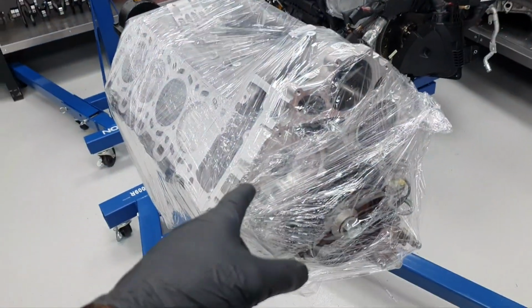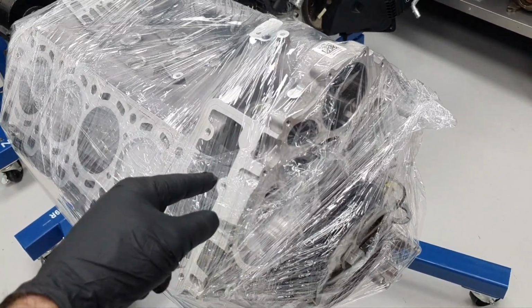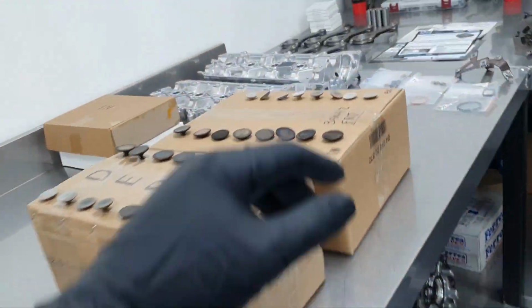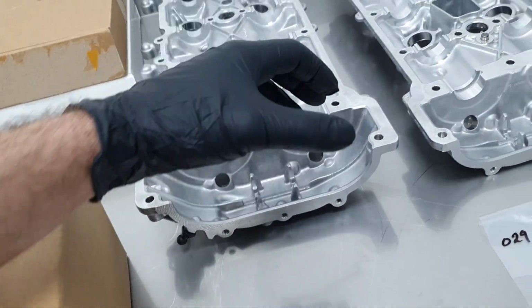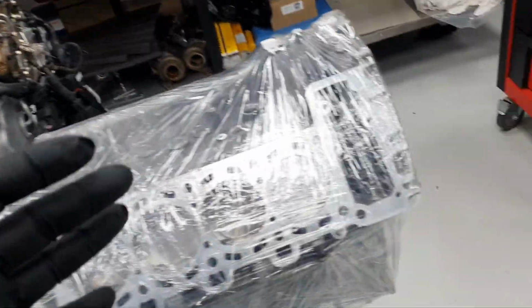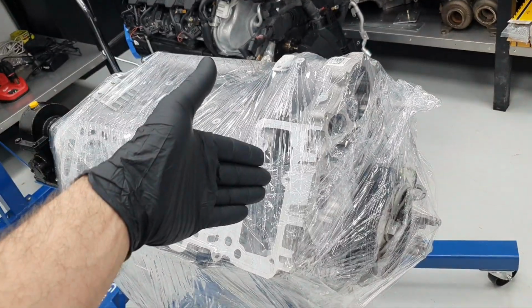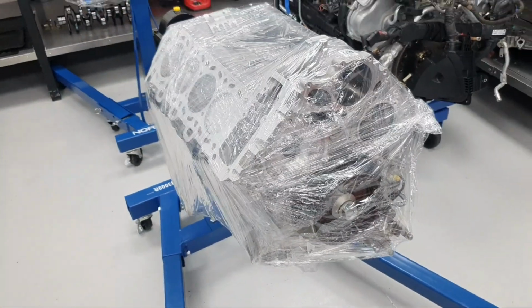Regarding the timing chain guides, they're not burnt, they don't have wear. It can last at least 200,000 kilometers. And how can I see that? The first guides that burn are the guides that have the cylinder head cover up here. I'm talking about the guides that are coming here and here. Usually, if it's burnt, when you're squeezing it to unlock it, to take it out, they break the ears. It didn't happen in this case. So the guides are not burnt. I didn't see anything to indicate that they're burnt to begin with. That's why I'm reusing them again. And like I said, as soon as the timing tools lock nicely, and the engine was on timing, I don't have a reason to change the guides or the timing chain. There is nothing wrong from this point of view.